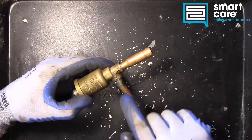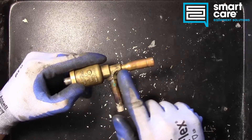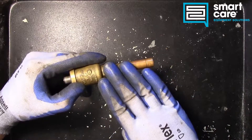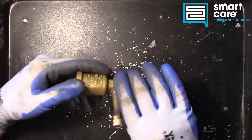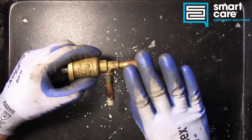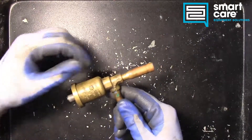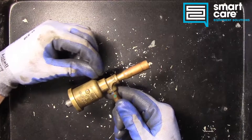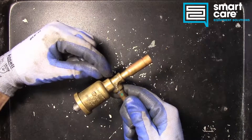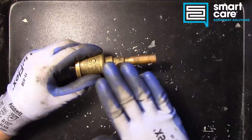What this does is it allows a computer or microprocessor controller to step a plunger up and down in very controlled increments and change the amount of flow through this valve. That electronic controller has much more flexibility than just a regular solenoid on and off. It can move this plunger in several thousand steps in very very small increments, so that distance between full closed and full open can have any one of several thousand positions, giving it very fine control over how much flow goes through the system.